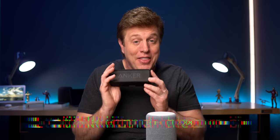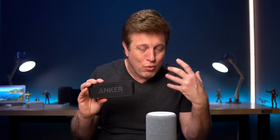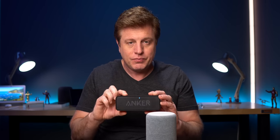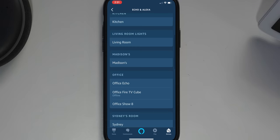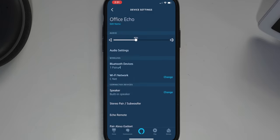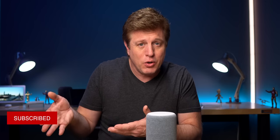Now let's connect a Bluetooth speaker. I'm using an Anker Soundcore speaker — a great little speaker at a great price, under 30 bucks, with pretty solid sound and good battery life. You can check it out with the link in the description. To get started, put your device into pairing mode. Then open up the Alexa app, go to your Devices, select the Echo you want, select Bluetooth and pair a new device. Your speaker should show up. If it doesn't show up the first time, try closing the app and reopening it — for some reason this app gets a bit unreliable at times. When you see your speaker in the list, select it and you are paired. Now that you're paired, next time just say 'connect my speaker.' From there, all your Echo sound will go through that speaker.